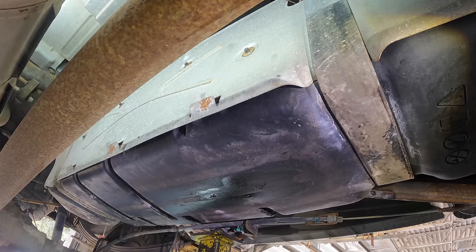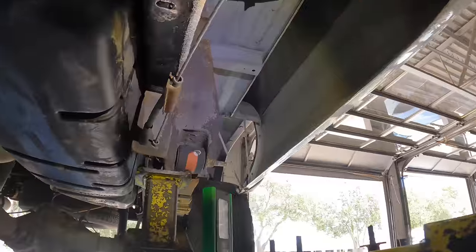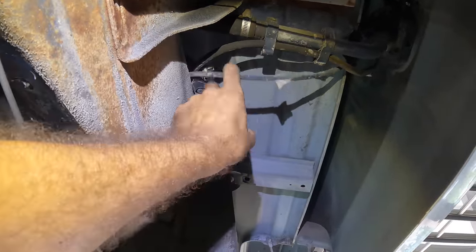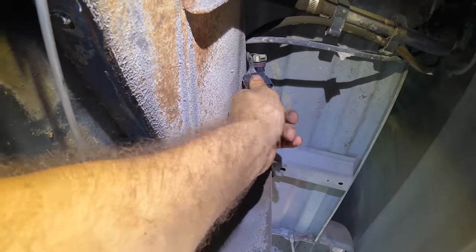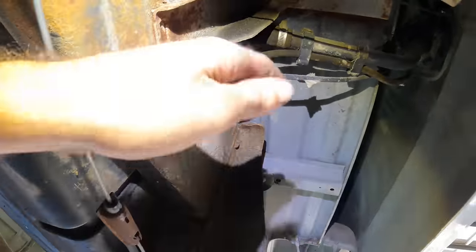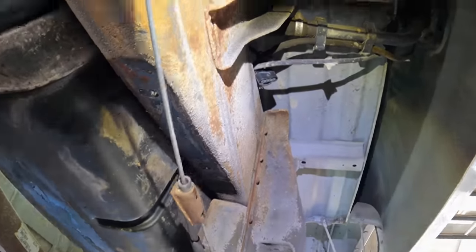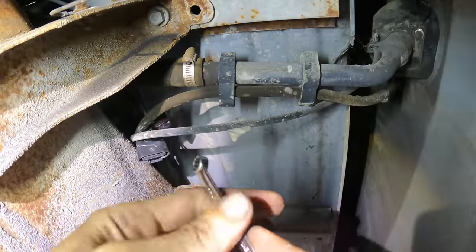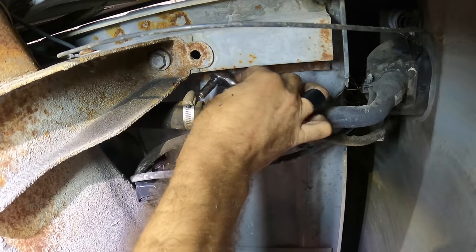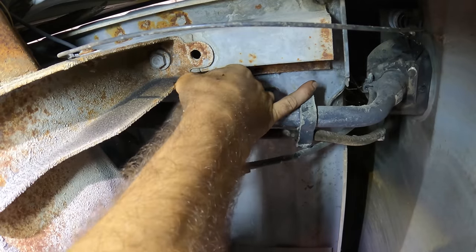We have to disconnect that next. All right, moving on over. Yeah, there's the goods right there. There's our fill tube, vent tube, and earlier we already disconnected the connectors from the pump. So once we get the tank loose, we'll drop it down some, disconnect the fuel lines, and then we can let the tank all the way down. So this is kind of fun. The clamp is pointing upwards, so I'm just gonna go in there with a little ratchet. Maybe. Yep. Oh, victory, this is good.